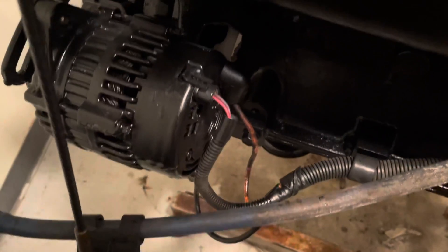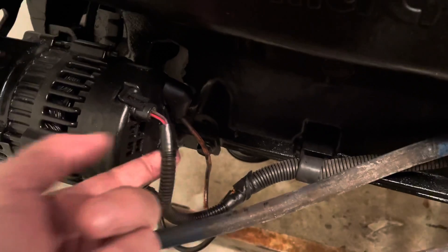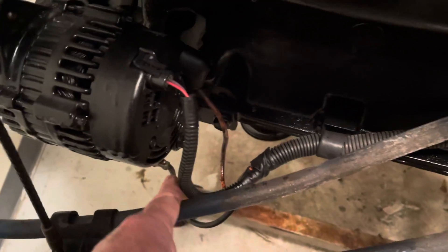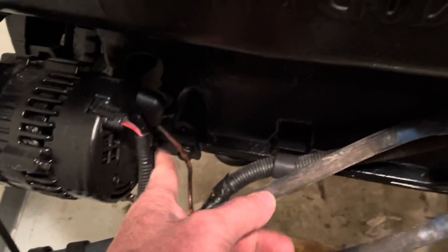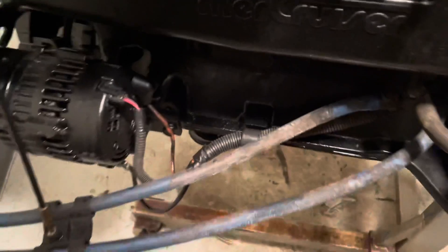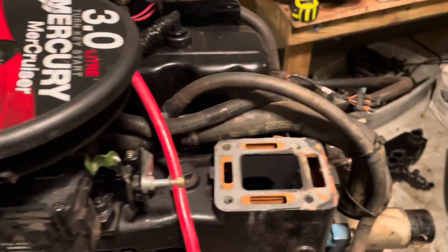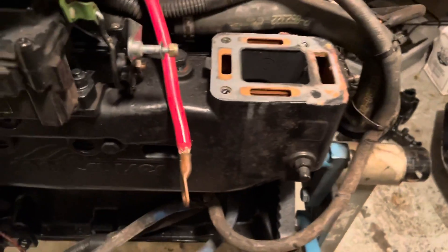Your alternator — there's the back of the alternator. You've got a plug which you can't mess up. You've got a ground wire strapped to the alternator and then your output from your alternator. Very simple. A fuel line connected there on the carburetor. And that's about it.